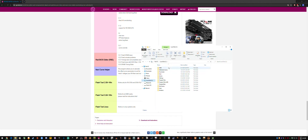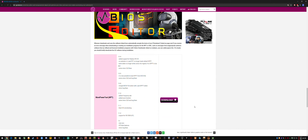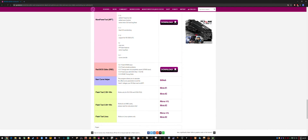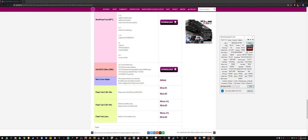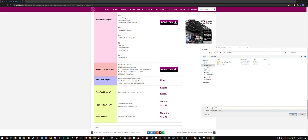You also need GPU-Z — just Google it and it should come up on TechPowerUp. The version doesn't matter too much; the latest is good. The important part is to start the program, run it, and save to file. For my RX 5700 it defaults to saving as 'navi10' — that ROM is your stock BIOS pulled straight off the GPU.